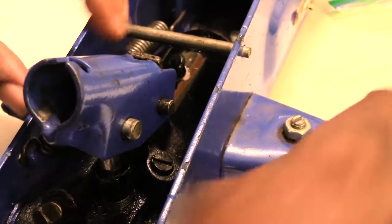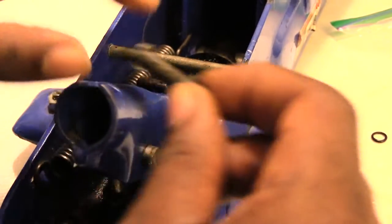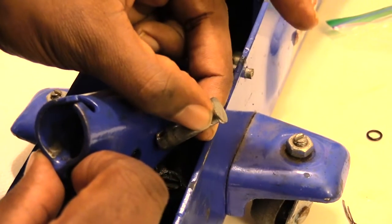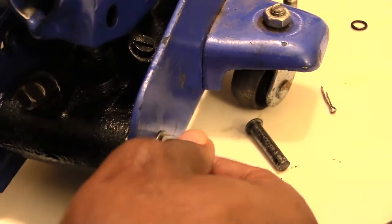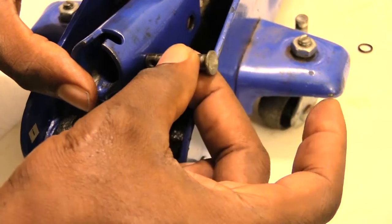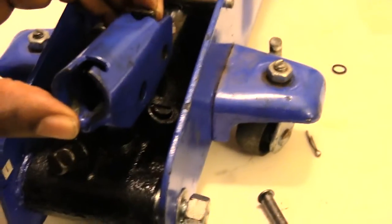Once you do that, go ahead and push these little things out — they'll just pull out like that. Go to the other one right here and do the same thing. Sometimes you may have pins on this side and can't get it out because it's hitting the frame. What you can do is take a pair of vice grips, come right here and take off this bolt. That'll allow you to take something and bend the frame open a bit so you'll be able to get this piece out.